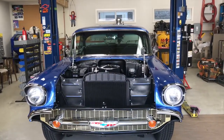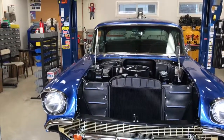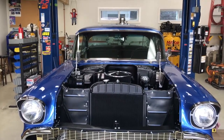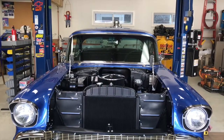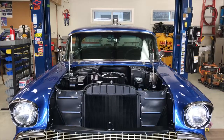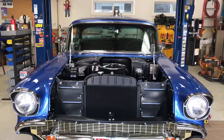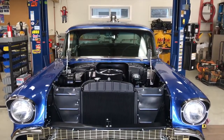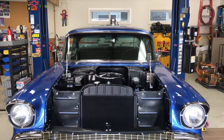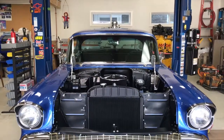So it's an Edelbrock carburetor, 1806 series. And we've been playing with what's called step-up springs, which change the amount of fuel it gets once you start to open the throttle. It's like an off-idle circuit. I talked to an Edelbrock tech, somebody that's been doing that for 25 years. He said, what you're describing, there's 4 or 5 sets of springs that come with this little kit.